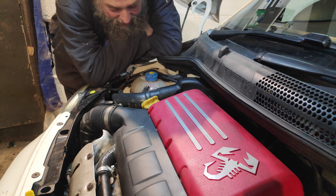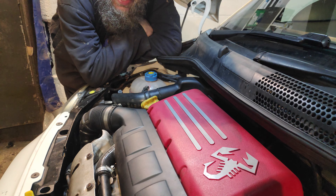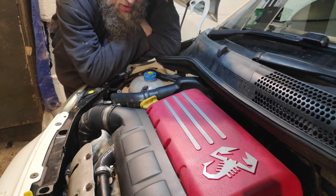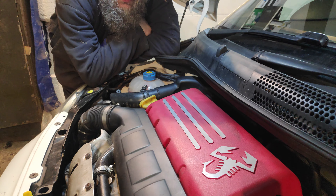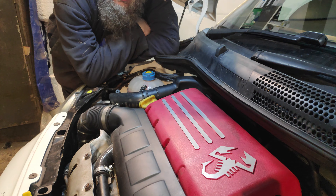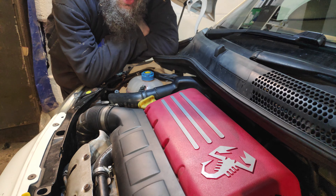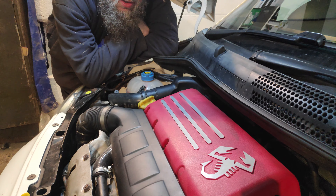What I'm going to do is whip all this off and run it without the auxiliary belt to make sure there's nothing connected to that causing the problem — it could be the alternator again. I'm more inclined to think it's something to do with the timing belt or water pump. I've also had those go faulty almost immediately — whether I tensioned it incorrectly, I'm not entirely sure. You line the marks up, you're good to go. It's a bit of a chore but that's what I'm going to do.